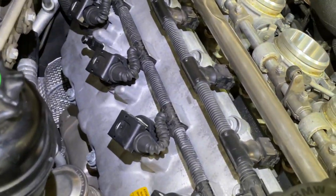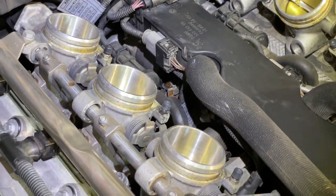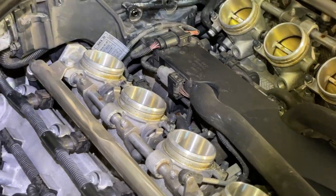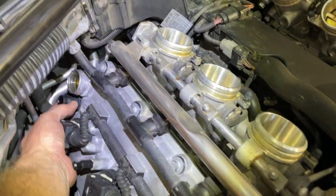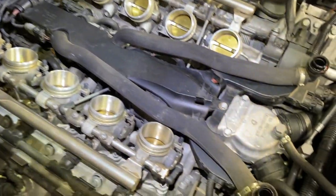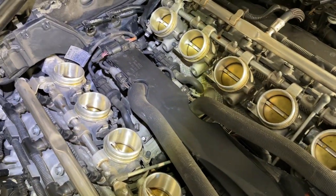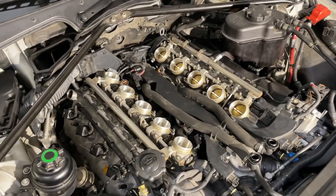It helps to remove the beauty cover over the plugs and coils to get that last hose out of the way. Make sure you've got all five hose clamps done — cylinders four and five require a short extension and a 12-inch extension respectively. Once the plenum is lifted up and out of the way, you can see the throttle body actuators and idle actuators. The wiring harness needs to be almost entirely relocated from the valley to access all four actuators.